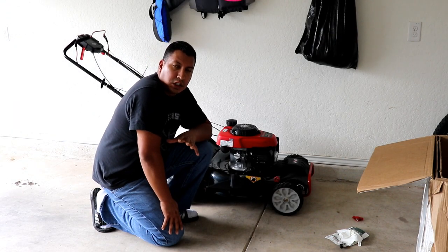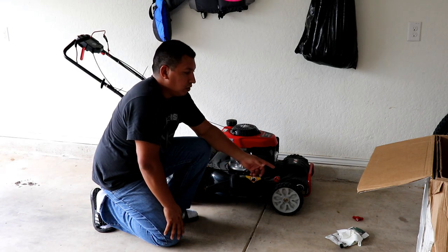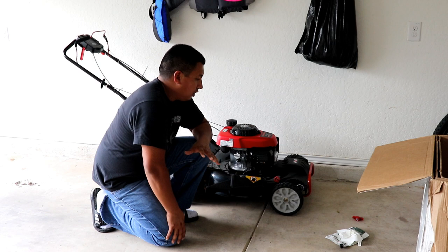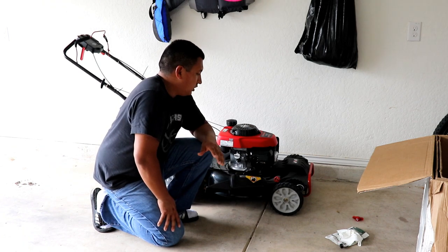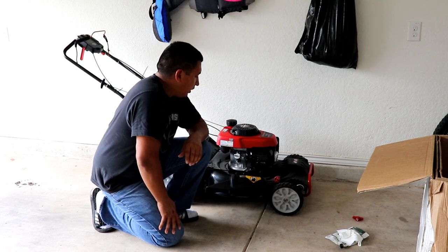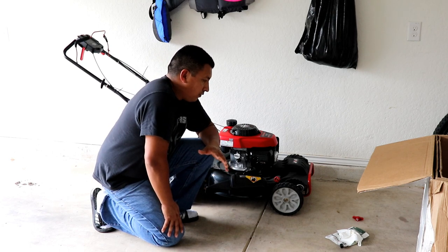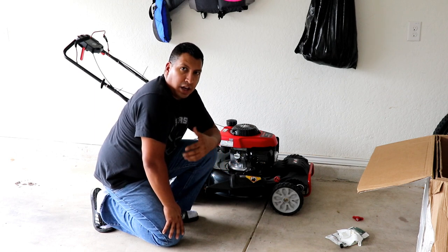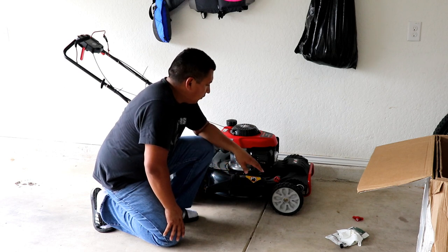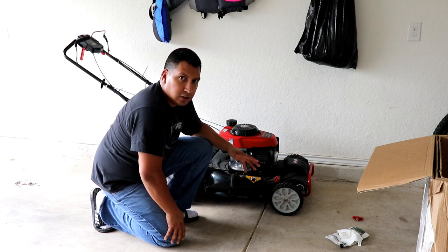I gave it a quick test run just to see how it would perform. The first thing I'll need to do is go to Home Depot and get a carriage bolt for that last wing nut so I can get the handle 100%. The mower seems good. The only thing I'm a little concerned about is the exhaust was smoking a lot and there was a real bad burning oily smell. Maybe that's just because it's brand new and running for the very first time — as it progressed it did start to go away a little bit. Just a few little wisps of oily smoke now, so I'm hoping it's okay.